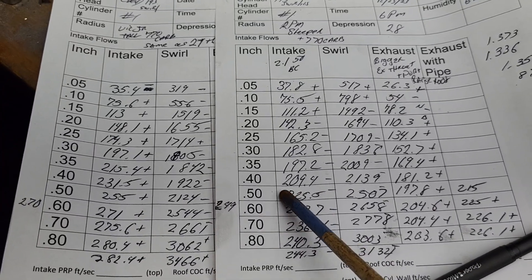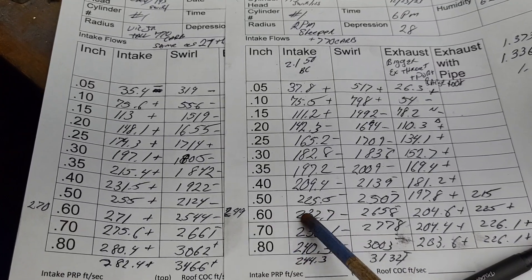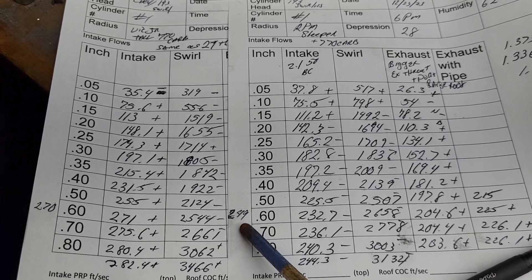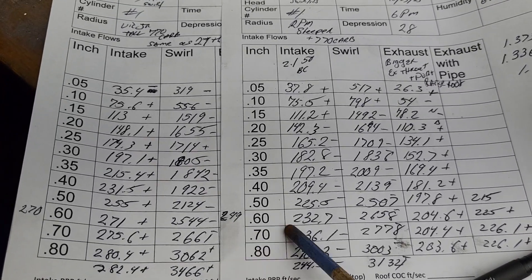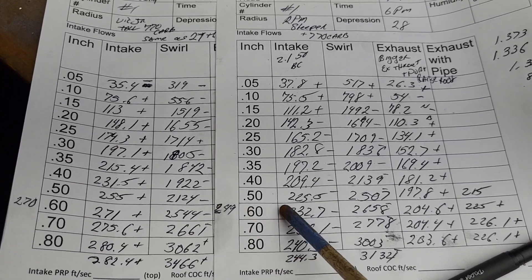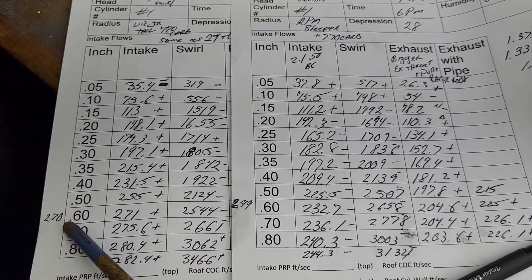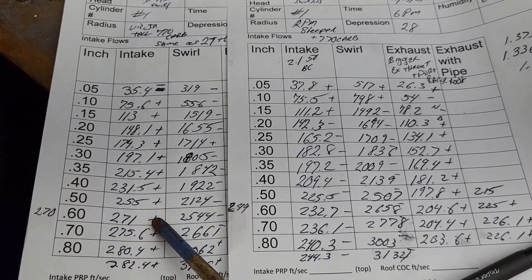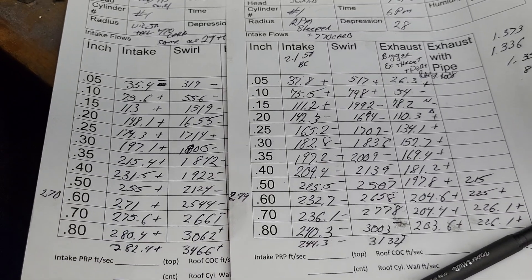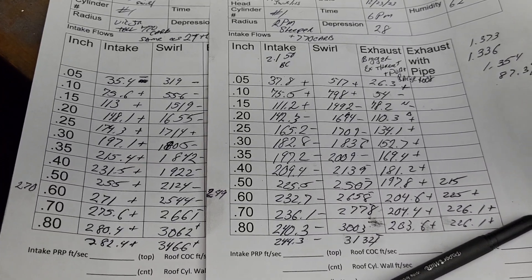Just like before, I took the carb off and it went 249. You can see there was a restriction with the carb — it still has part of that divider up, so it's sucking the majority of its air through two barrels and leaking some across the other two. Take the carb off and it flows almost identical — that was a surprise. It's strictly an open intake manifold without a radius or anything on top.